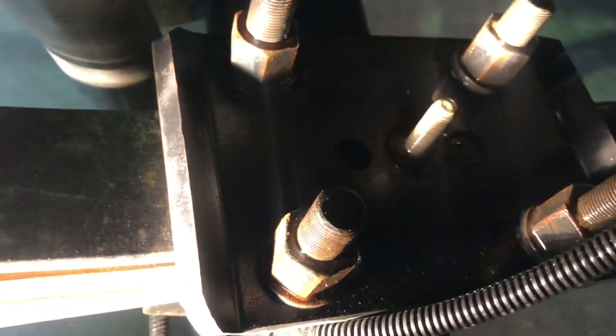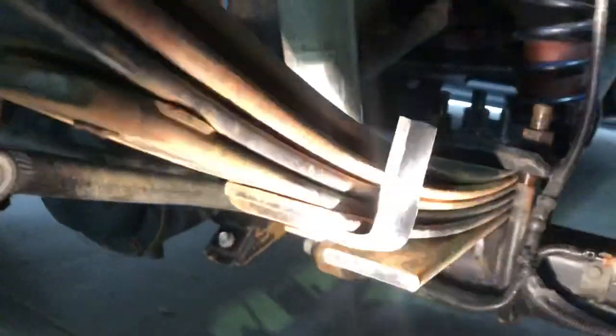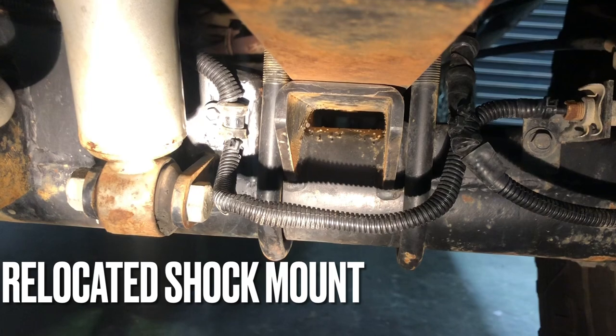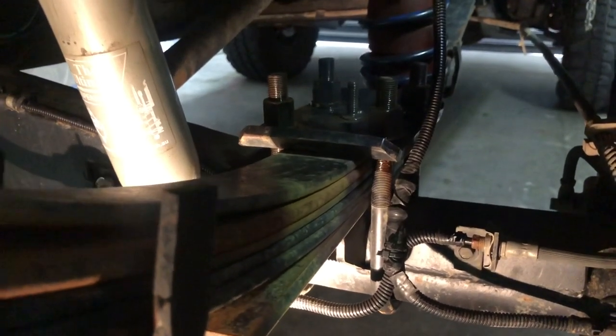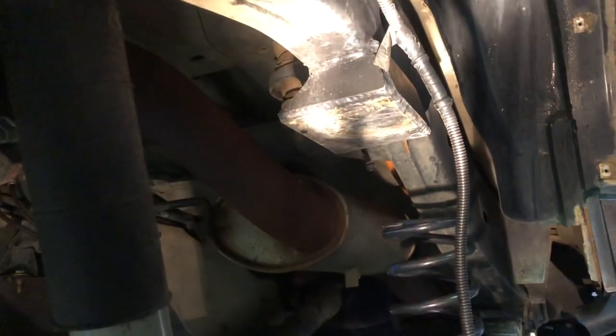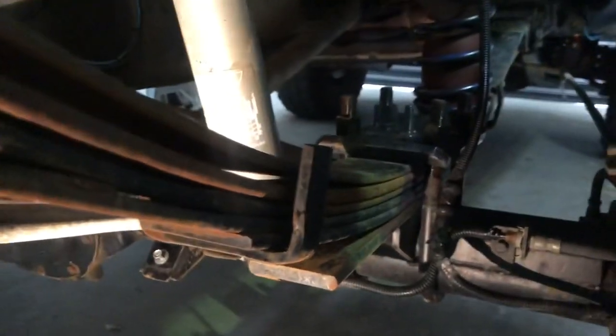So going back to the leaf over, the rear is standard, sorry, nothing's changed there. The leaves themselves, as we said, we took away the retainer over the top there and basically welded a perch onto the rear axle after cleaning up everything from the old setup, and basically located that over the top. So it wasn't a massive job to do the leaf over. You see at the top, we had to create something for the bump stop to sit on. But all in all, it wasn't an overly hard job to convert it to the leaf over. So I'll leave you there.